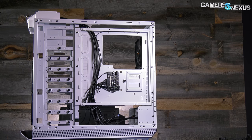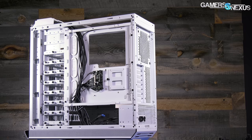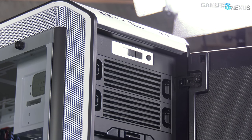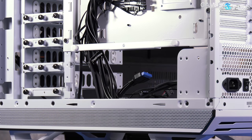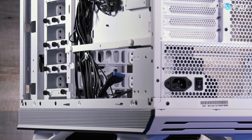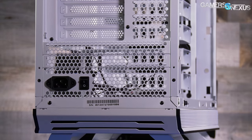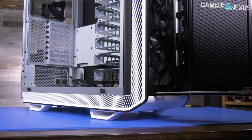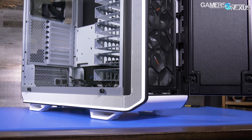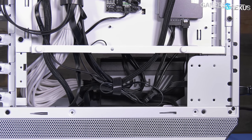There's an optical drive cage, but if it's removed, you can replace it with an additional fan bracket. The front five-and-a-quarter inch bays are mesh covered, so there's actually mesh to deal with dust even if you don't install a fan. The only concern we had looking at the empty case was the lack of power supply ventilation — an unfortunate consequence of being invertible. The PSU needs to be able to shift side to side, requiring two sets of screw holes, leaving a small strip of ventilation in the dead zone of the power supply fan. We chose to flip the PSU and draw air from inside the case for our thermal tests instead.